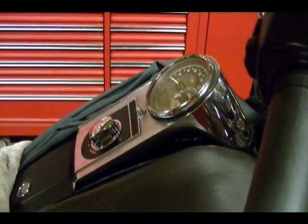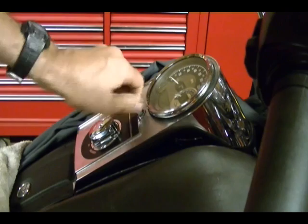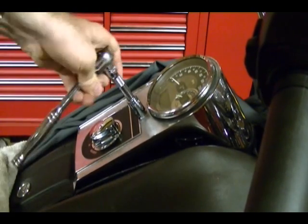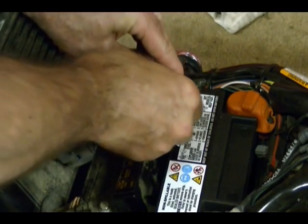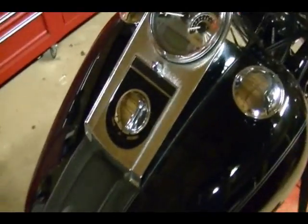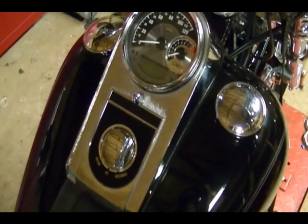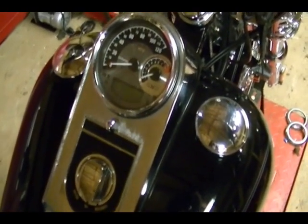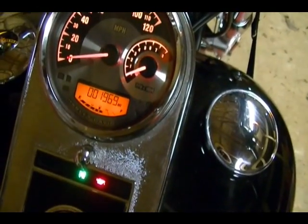I've got the console back in place and I'm ready to reinstall the acorn nut. I don't have torque specs for this — it doesn't have to be too tight, just a light snug. Now reinstall your maxi fuse and place it back in its holder. Now I'm going to turn the ignition switch to the ignition position and verify that my correct odometer reading was copied over correctly to the new speedometer, and also check to make sure everything is working on the bike like the headlight, tail light, and turn signals. And you can see that the correct data was copied over to the new speedometer.